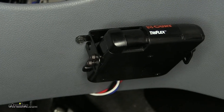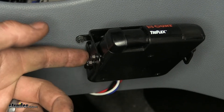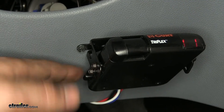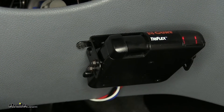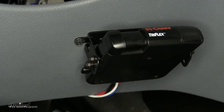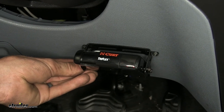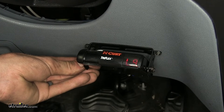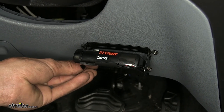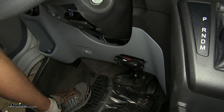On the very far left side of our brake controller towards the back, we have a slider adjuster knob. This adjusts the sensitivity of our brake controller, so the brakes will be applied quicker and more aggressively depending on how we have it set. There are nine sensitivity level settings, so you can go from level one all the way up towards nine. Now that we've gone over some features, we'll show you how to get it installed.